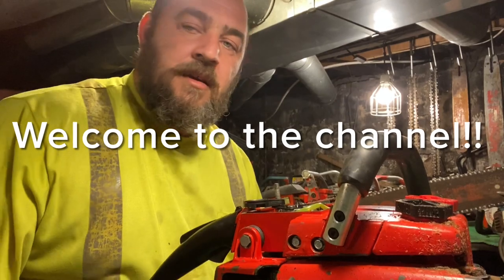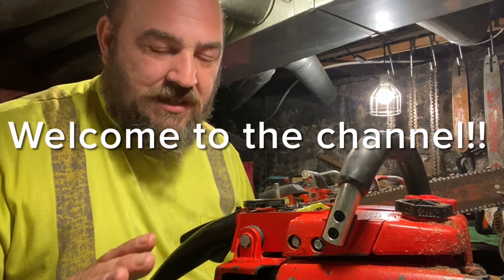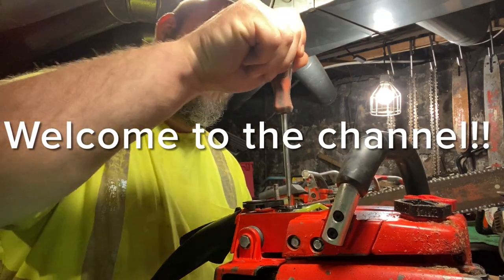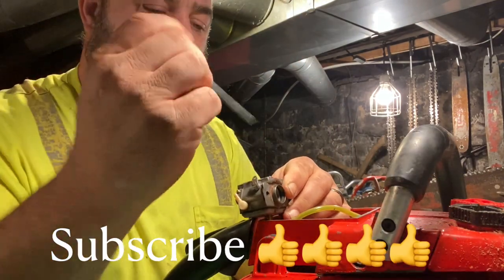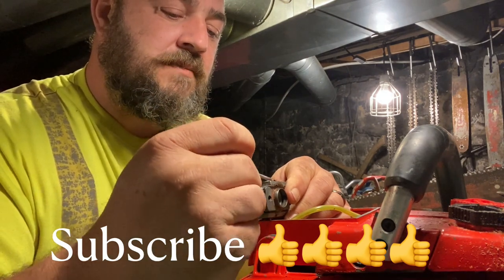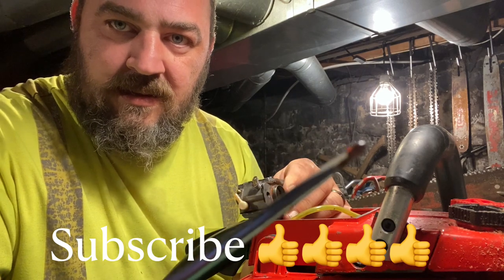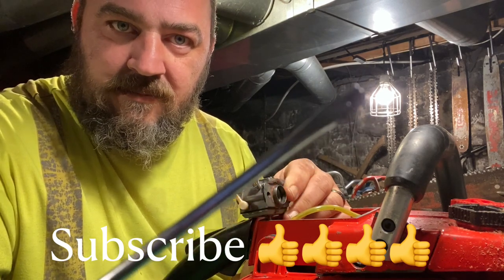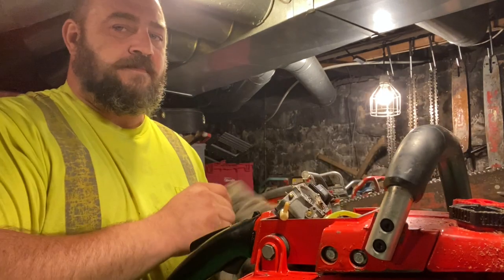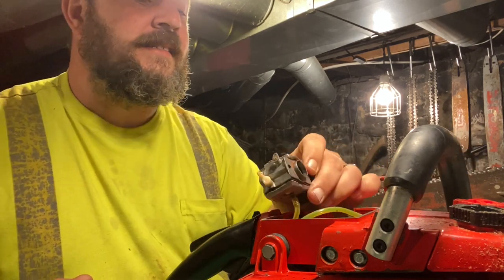I'm going to play with this 360 a little bit. I'm having trouble - I can't get it to pull enough fuel, and I believe I just need to make a minor adjustment to the metering. So I'm pulling this off and I see an issue. You see it - a tar-like substance. Maybe that's why it went lean. That would explain things, wouldn't it?